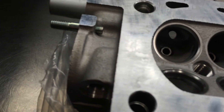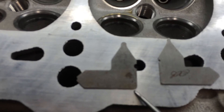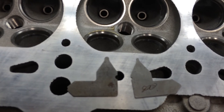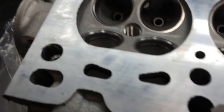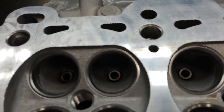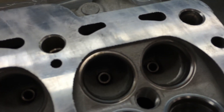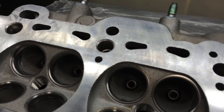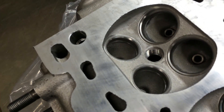We're basically checking this radius right here — there's my finger to give you an idea of scale. Very, very small radius. There's not enough room in there or enough material to put anything larger. The maximum I've seen being done is a 60 thousandths radius in that area, and that's the area that is kind of a gray area in the rules — or as others describe it, an open area. These cuts are on every hole, all four, each chamber — the entire head, obviously.